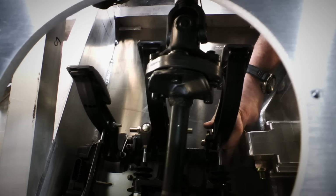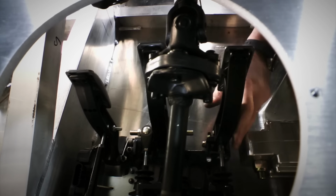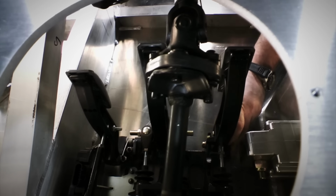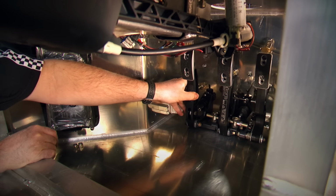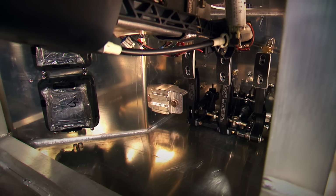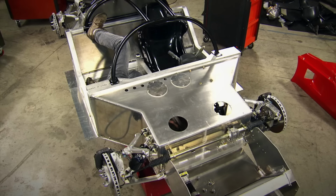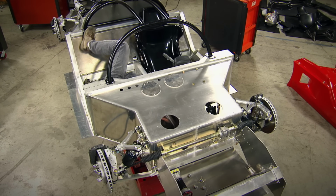The only drawback to this system is that it was designed for racing and competition vehicles that have flat floors and firewalls. So, to graft them into a factory vehicle will usually require extensive metalwork in the toeboard and the firewall area to get everything fitting and looking right. But if you're building a kit car or a competition vehicle, this is usually the best way to go.